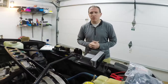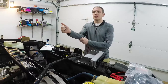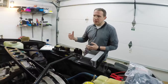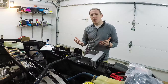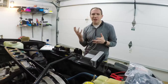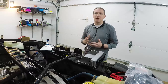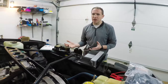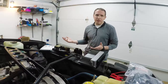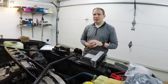It's just a brief built, heavier duty four-speed, nothing major other than internal engine work. I'm sticking with the same Opti-spark and same PCM, which is kind of the big problem on these engines. This Impala had the same Opti-spark for a hundred thousand miles no problem, then my dad changed it just for safety - worked again for another 80,000 miles. So I've never had Opti problems, and now I'm running the MSD billet unit.